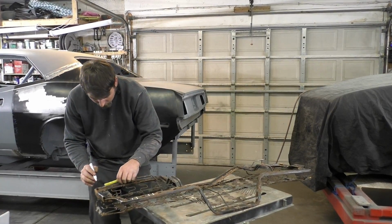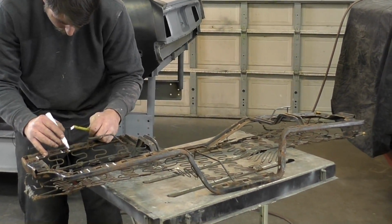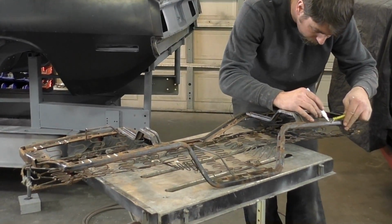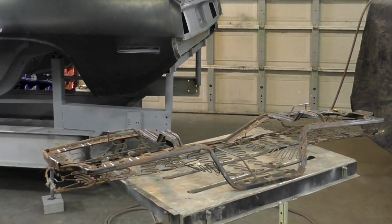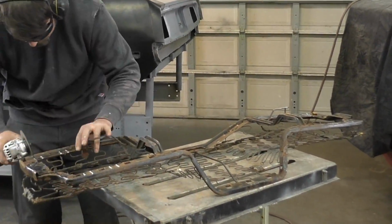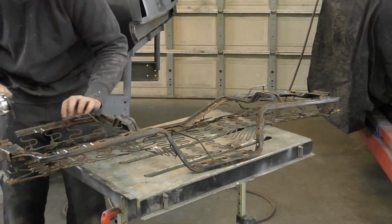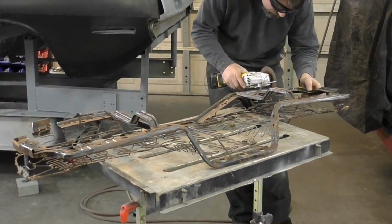So there's our 3/4 inch there. You might be asking, why are we cutting the front and rear sections when the rear sections are the only thing binding up? What I found in the past is when you cut just the back of them and kind of bend it in, it puts the seat in a weird bind and kind of lifts up in an unnatural state. By cutting the front and rear, we're not binding the springs, we push them closer together.